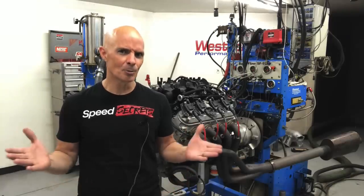And I use the air quotes there because a number of the cams are actually not turbo cams. Take the factory LM7 cam, definitely not designed from the factory to be a turbo cam. And yet, we run boost on it all the time. Same thing with the LS9. That's right, I slipped an LS9 in. Now, not only is the LS9 not a turbo cam, it's not an NA cam. It's a blower cam. And yet, we ran it NA and with a turbo. Does that mean all cams are turbo cams?